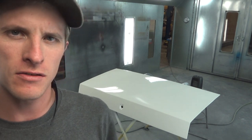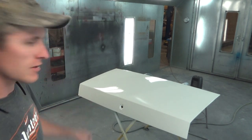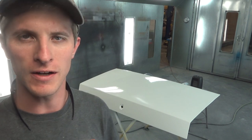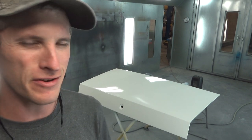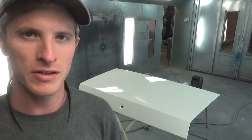I did not get a chance to record the priming process, but we did put primer on this panel. Everything looks good — a couple of sand scratches, a few more than I'd like. I'll let our polyurethane primer surfacer sit for probably a week or so before I put any top coats on it, so I shouldn't have any issues with shrinkage. I got three nice coats of epoxy. The shop heat is on — should be about 80-85 degrees overnight to let this cure. Tomorrow we'll do a little hand block with 150, then maybe a little spot filler here and there, then get our polyurethane on it.